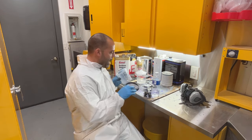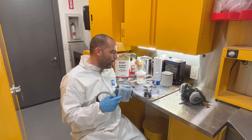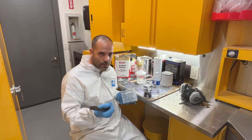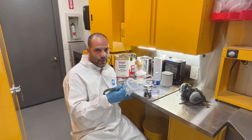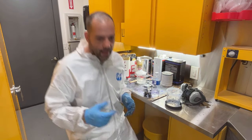But I noticed that when the heat starts creeping up in there and it starts getting warmer and warmer, that means that I'm getting less air leaving the spray booth. Also, you can tell if more overspray starts getting in the air and it's taking longer to exhaust. That's another reason to clean your filters or change them. So, all right, I'm going to get this stuff cleaned up, and I'll come back and we'll take a look at it.